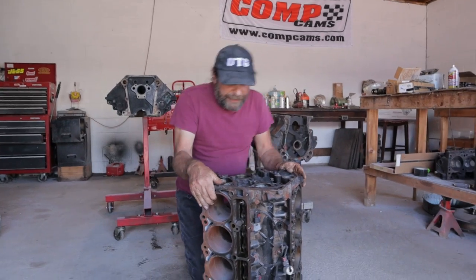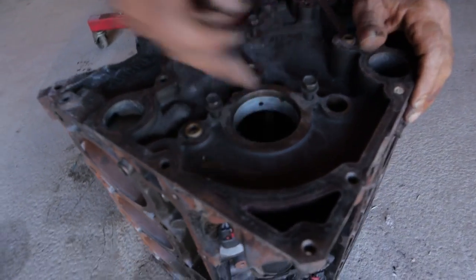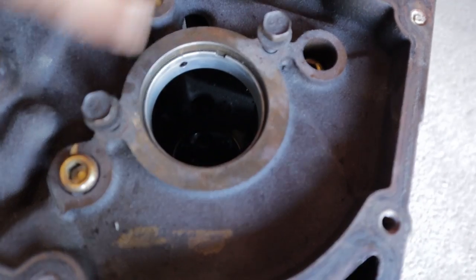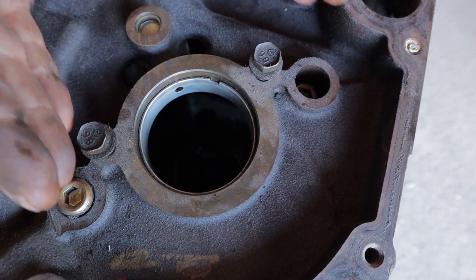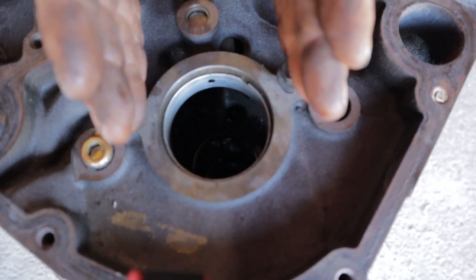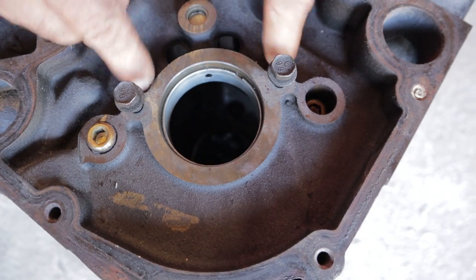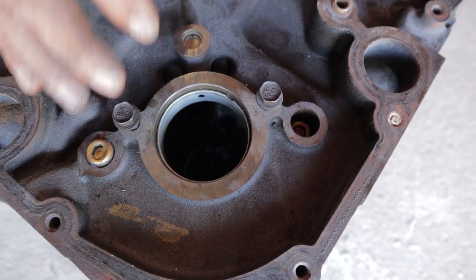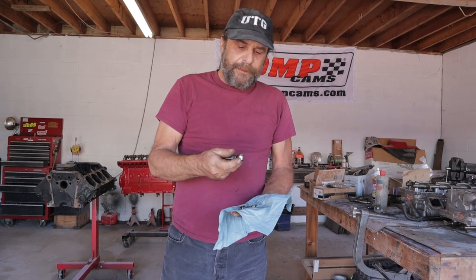You can see right here, just to put it in perspective, here's the bottom of the lifter bore, right? My hand is on it right now. And obviously, this is the outboard edges of the camshaft, and look where our lifters are, right? Any drainage between the lifter bore and the bottom of the motor is here. It's outboard of the lobes. They never get any.